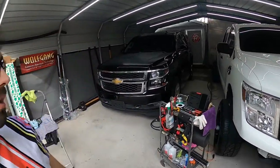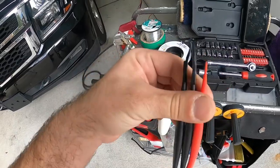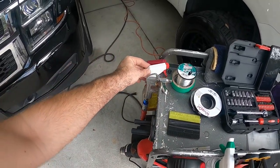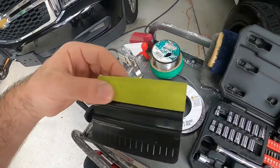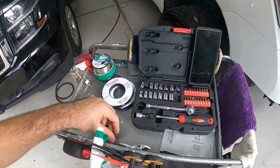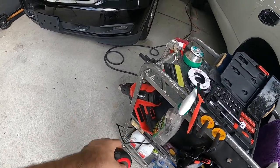I'll give you a quick rundown of my cart before we start cutting the piece for the hood. Basically you're going to want some magnets, some little tools for specialty tucking, easy access to all your cleaning solution, Goo Gone and stuff like that, knifeless tape, some fishing line for taking off emblems, maybe a little tool kit, microfiber towels, a squeegee, a 30-degree blade razor, and little pliers to break off the razor blade.